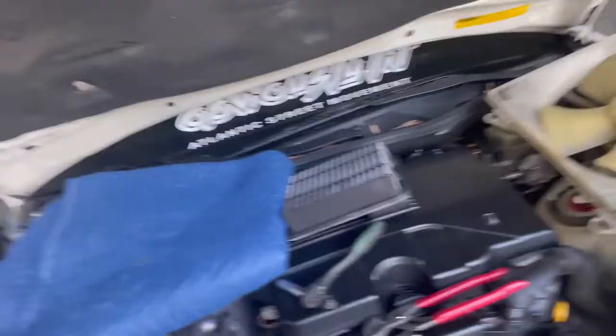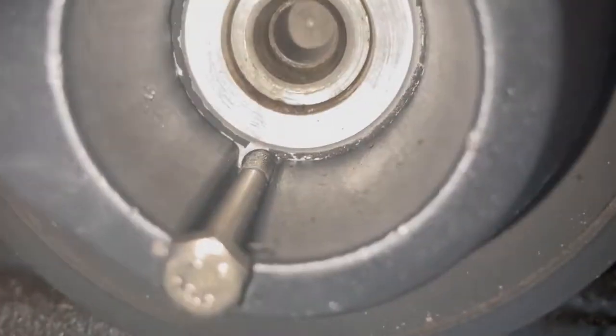It's out! It's right here in my hand. The center bolt is out. There is another tool I'm missing — apparently it's a pulley puller. It has ears and three screws that go in, and it's gonna pull the actual pulley out from where it sits. Where I just took that screw out, that's where it goes in — you tighten it and it pulls out the whole harmonic balancer. I'm probably calling all this the wrong name and I honestly don't care. I just want my car to run, so I gotta go to Harbor Freight and get that.